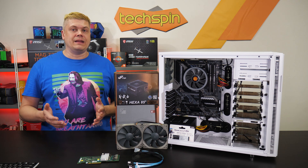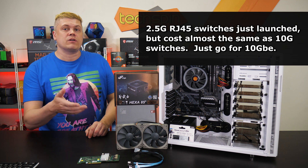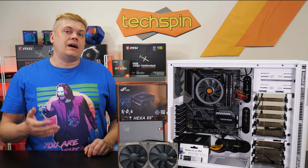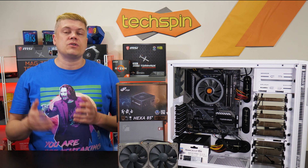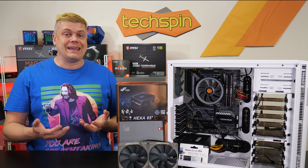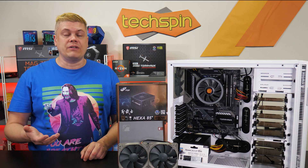Good old RJ45 gigabit networking — at least for now — where an 8-port switch is super cheap at just $20. Newer hard drives deliver around 170 MB/s, SSDs max at around 500, and we'll need to test Unraid to see if it reliably pulls whole projects into the ultra-fast cache area to be worth the 10 gig upgrade. Don't forget the drive on your PC needs to be a super-fast M.2 drive as well.